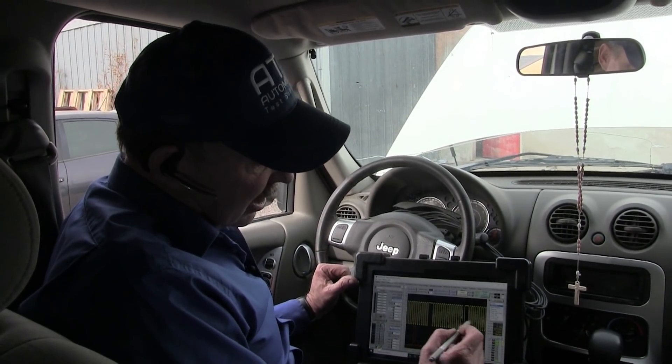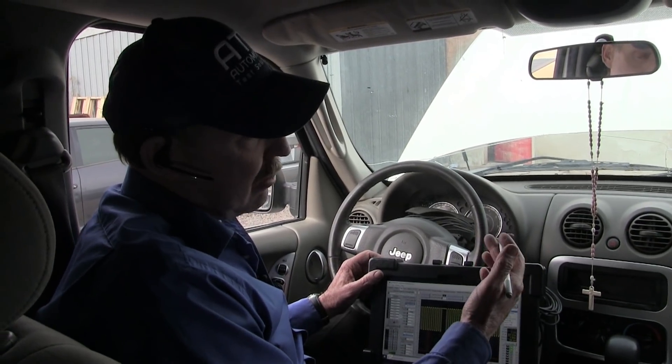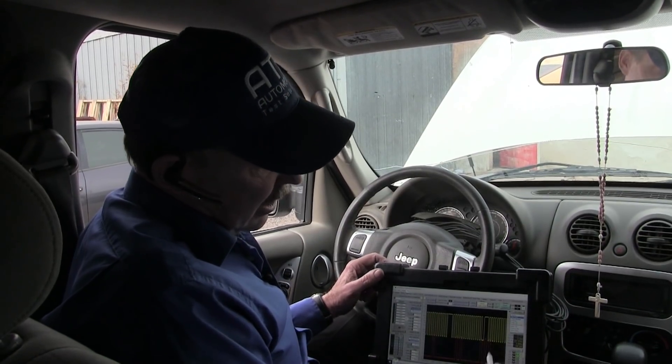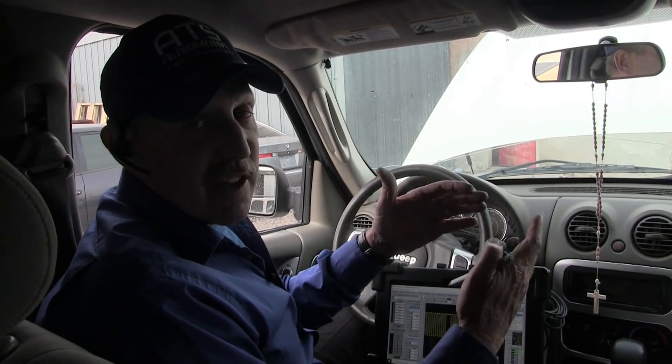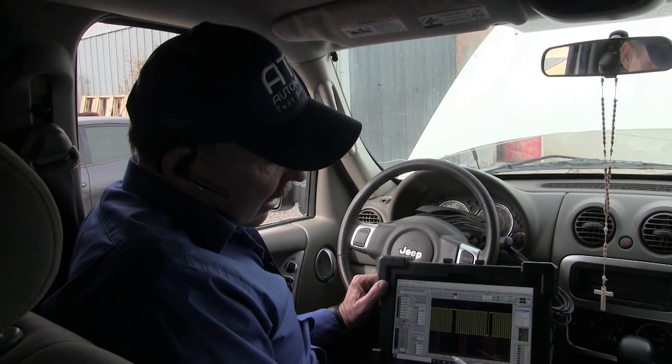What's really happening is this is a crank failure — crank sensor failure. Whether it's a power or ground or the sensor, we don't know. You could have a triggering problem where the trigger wheel could cause something like this if it's bent or if the magnetic intensity somehow isn't working correctly with that target. But let's go get the powers and grounds and go from there.